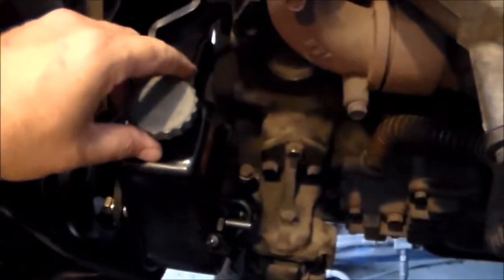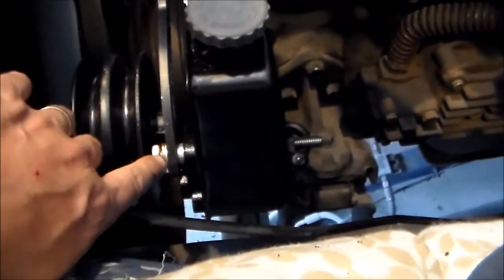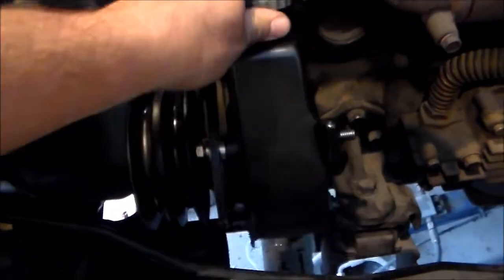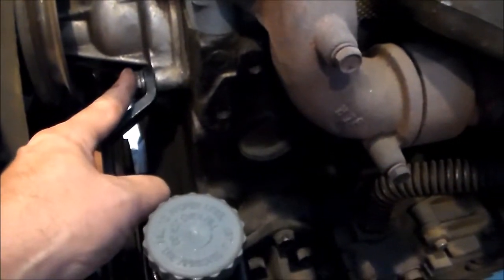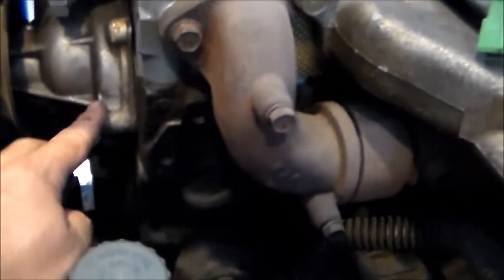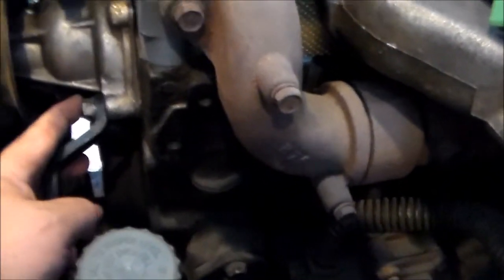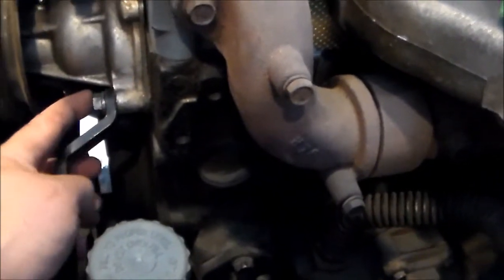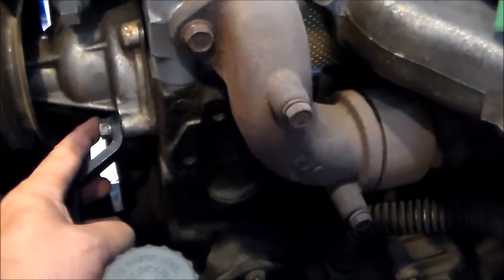Here's another view of what our project is starting to look like. I mounted the pump — it drops down on the bracket, there's a bolt on either side. We have a slide adjustment bracket bolted to the pump with a big slot so the pump can be moved back and forth for adjustment. You also need to remove the bolt on the bottom of the water pump — that's where this bracket attaches. When you take that bolt out, you'll more than likely need a longer bolt by the thickness of this bracket. I also recommend putting a little silicone sealant on that bolt, because it goes through the water pump and you don't want a leak once everything is together.